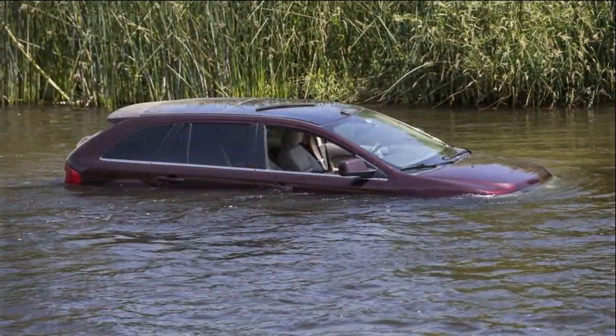Well, what's considered underwater? Well, total submersion of it, or partial submersion is what they're getting at. So if you drove through high water and flooding and it was coming into the car, I'm going to bet you that you got it submerged. So you have to play that one by ear, but anytime it's underwater, I think we got, what, 6 or 8 inches or whatever it is before it starts touching up in there. So your clearance is going to have a lot to do with it. Why you're driving through water that high, I don't know. You probably shouldn't for safety reasons. But as far as the axle and PTO fluid, it should be changed anytime the axle is underwater, and then during extended trailer towing operations that are above 70 degrees Fahrenheit.